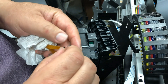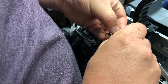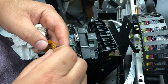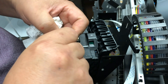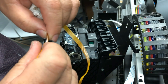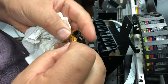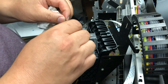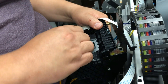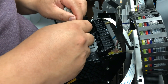I don't know how many times I've installed it backwards — the teeth side should be inside the loop. If you feel along the belt, you'll see a small section has bigger, thicker teeth, and that's the side you mount on the carriage return. The carriage return is mounted on the lower part of the loop, so the top of the belt is just a plain belt and the bottom gets attached. To check, you can get it done and put it on the printer without fully installing. Make sure the carriage return motor has good contact with the teeth, and then you'll know if you installed it backwards.